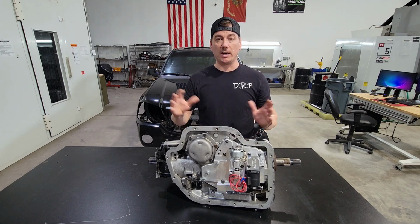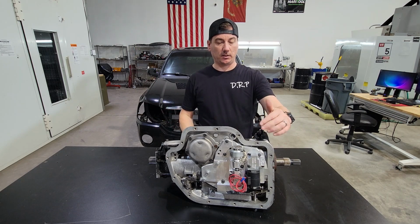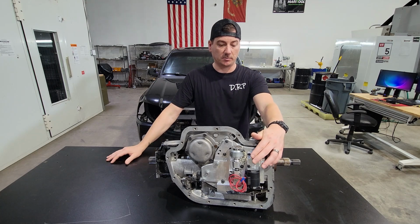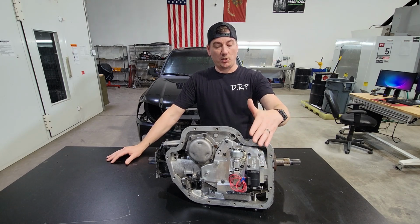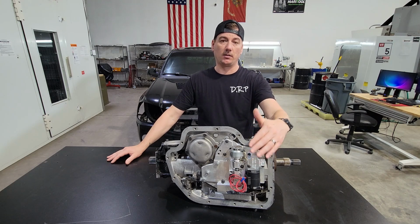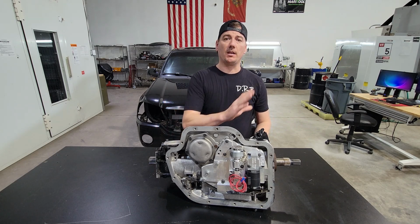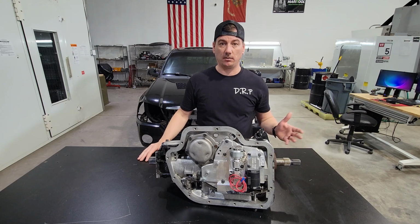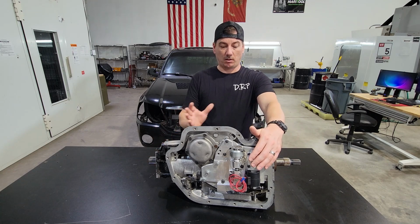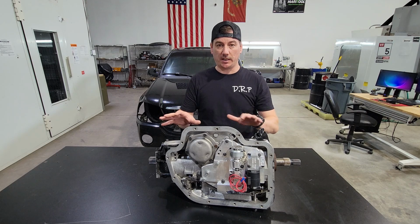And again, when you get into the higher level stuff, LDR, Pro Mod stuff and up, and there's other, what I would consider a lower class of racing, that do utilize very expensive transmissions. When you have those higher ends, what they're doing is utilizing this to help spool assist, get up onto their target boost without a whole lot of restriction. And then they're using the external dumps to help carry it out for the 60 feet, and they can use them all the way out, up to a second and 200s out. So you're definitely approaching 150 feet as you get out. You're still utilizing the external dumps, so that those systems can all work together.